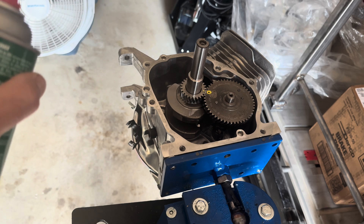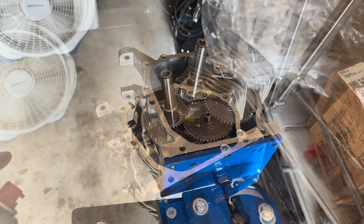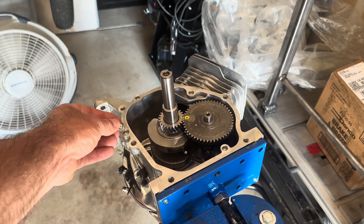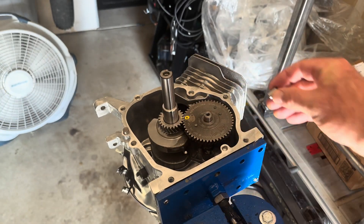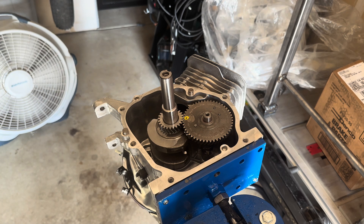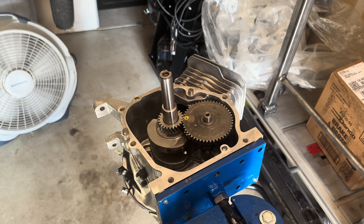We have our dowels. We talked about the dowel size on the Predator — I've enlarged these to 0.375 inches, which is 3/8 of an inch. I get these 0.375 hardened steel dowels from McMaster-Carr. The side cover has also been modified, and now I need to modify the gasket because it's most likely cut for an 8mm dowel. Even when you order one for the Predator 212 non-hemi, sometimes they come cut for 9mm, sometimes only 8mm. We're going to enlarge this one to 3/8 inch.